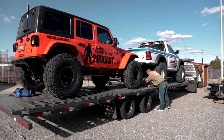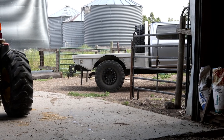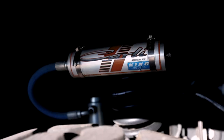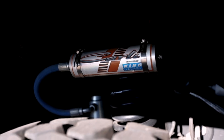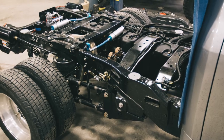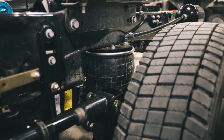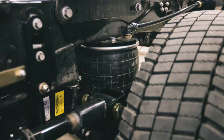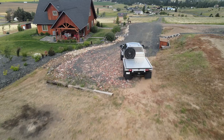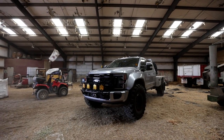Because we wanted to make this thing comfortable so that we'd show up at whatever event and not be wiped out from white-knuckle driving, we did some suspension upgrades which also help us clear these tires. Up front we did a Carli 3.5-inch kit with a set of their fabricated radius arms and 2.5-inch Kings in their pin-top setup. Out back, to handle whatever load we throw at it as well as get rid of any axle wrap from leaf springs, we added a Kelderman 4-link airbag suspension that utilizes some really big heavy-duty truck airbags. It's double duty for us — we know we can load up whatever we want and it's automatically going to sit perfectly so that the radius arm front end doesn't end up having any caster changes because of that change in angle, and lets us still steer really well and control everything.